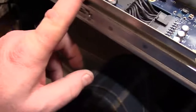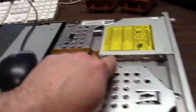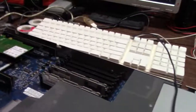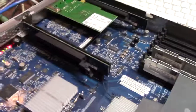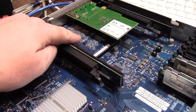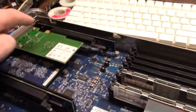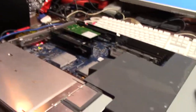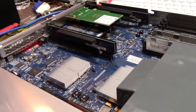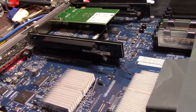This area is normally your RAID controller and power management where the power supplies come in. You have a DVD CD-RW — you can upgrade these to SuperDrives which are DVD burners, but I don't burn discs. Eight FB-DIMM slots for DDR2 667, which is PC2-5300 — remember these are 2006 models. This is an ATI card in what's called a mezzanine slot. You can also get PCI-X slots, the original white PCI slots, but I'm going to throw a fiber card in it for XServe RAID.